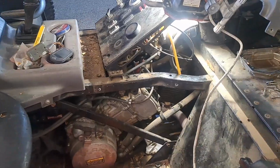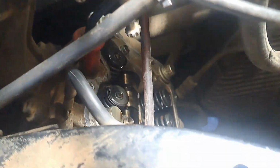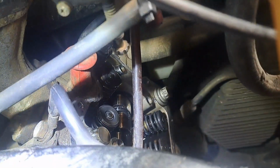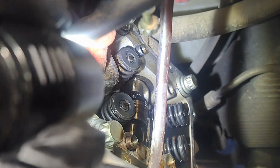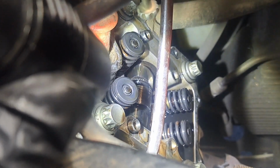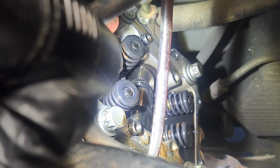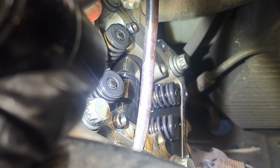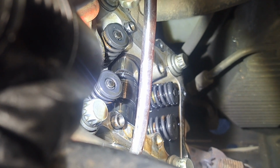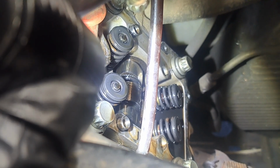Alrighty, so I'm gonna be really honest with you. This may be a little bit embarrassing for me because this took like 15 minutes to check, and I should have checked this before going through the carburetor and all sorts of stuff. But I'm going on my knowledge, and that's why YouTube is amazing, because even with a whole lot of training, I would not have jumped to checking this cam. I would have probably done a compression test, maybe even cylinder leakage. I'd have done all sorts of tests rather than just pull this rocker cover.